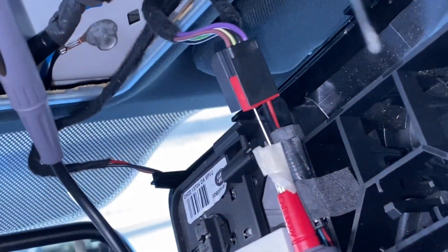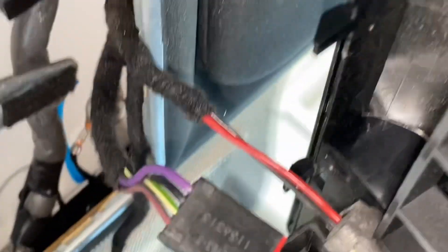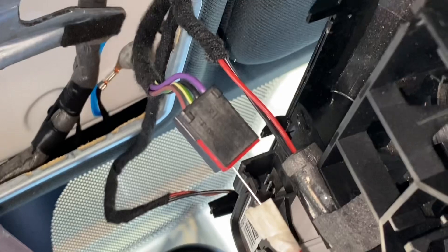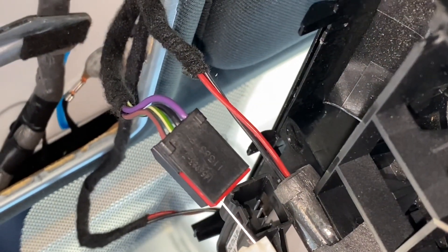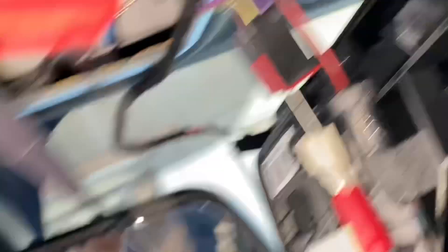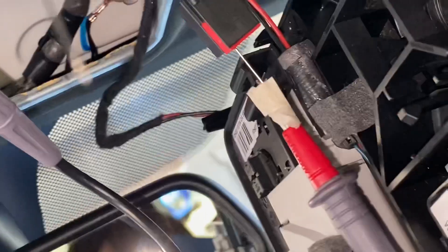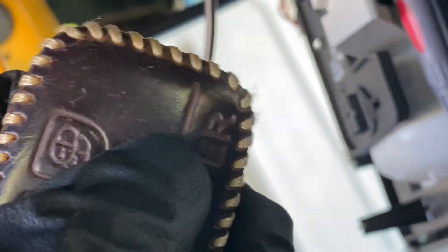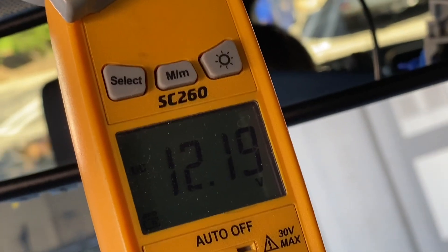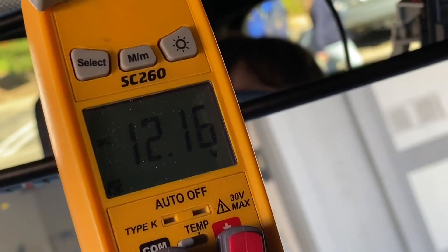So while the car is locked for about five minutes I'm still getting 11.6 volts at that black and brown terminal, and I'm getting nothing on the green and yellow terminal. What I want to do is reconnect this lead to the green and yellow, and then unlock the car to see if I start getting voltage there. I reconnected to the yellow and green — unlocking the car — and we start to have 12 volts. Interesting — basically it was expected.